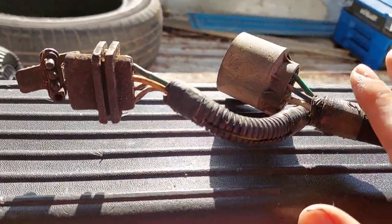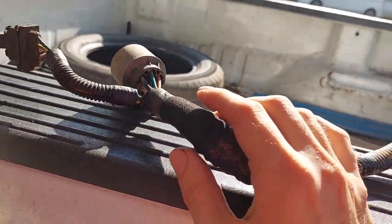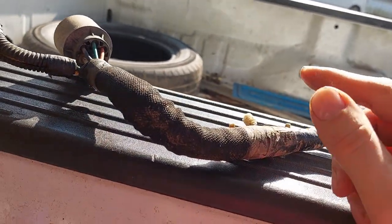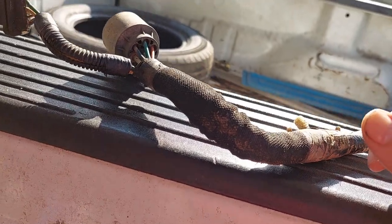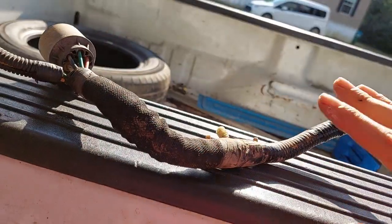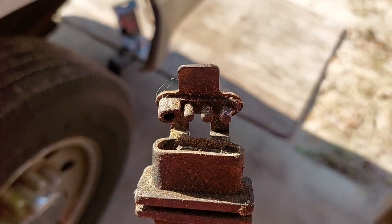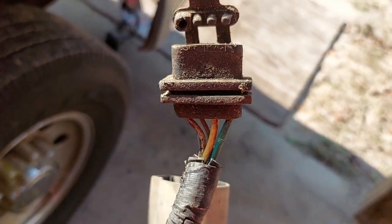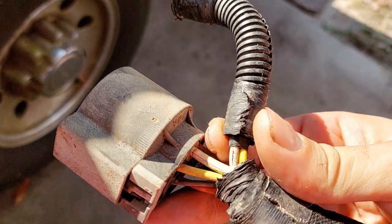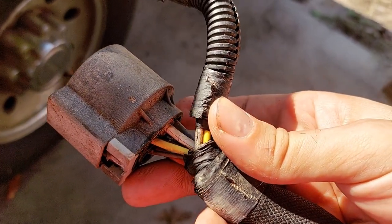So I had to come up with something else. I went to the junkyard and found a 7 and 4 pin harness — this entire harness came off of an Excursion. The pinouts are the same, the connectors are the same, it's about the right length, and I'm going to swap that whole harness leg because this one's in pretty good shape. The actual pins look really good and they're not corroded. The end housing is beat up and toasted, but I already have one of those with the adapter I bought. So I'm going to snip it down where the wires are badly cracked, hit it with some liquid tape to insulate it, and basically forget it exists.